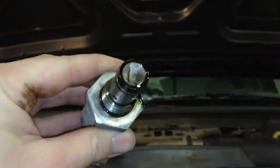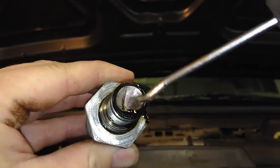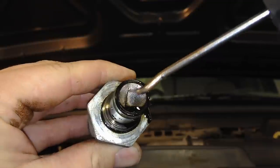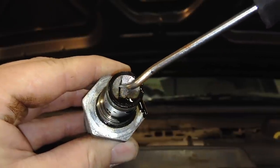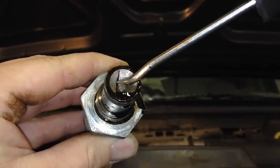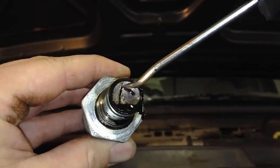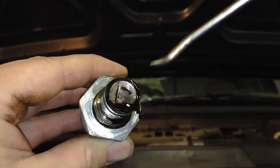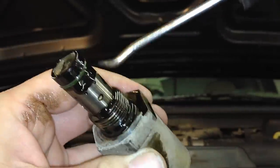This is the IPR I had to pull out of this one. You can see right here — that sliver piece of the filter actually blew right through here. I'll show you in a second what it looks like inside the oil filter housing, but you can see the large slit it put right through here, and that stuck the IPR open.